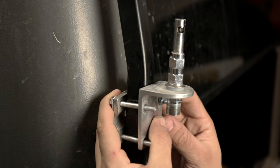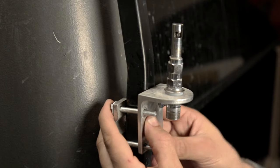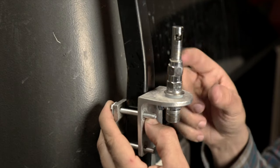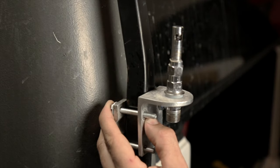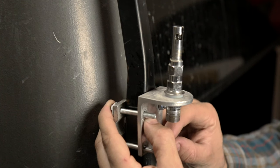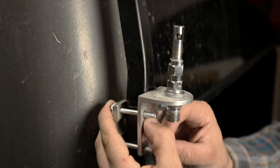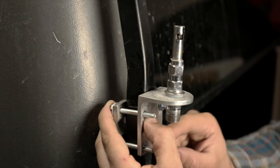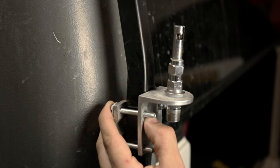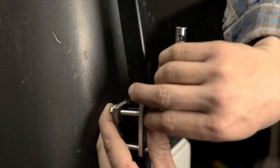This location is kind of perfect — it's easy to mount, I don't have to pull out too much cable, and it's still going to give the antenna enough distance over the roof rack that it should be easy to tune. That's a trick with CB antennas: getting them above the roof line not only helps your sending and receiving range, but it also lets you tune the antenna more easily because there's less interference from the body of your vehicle.